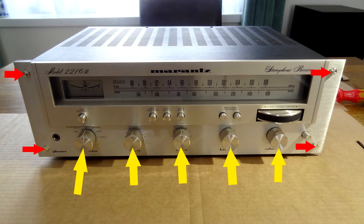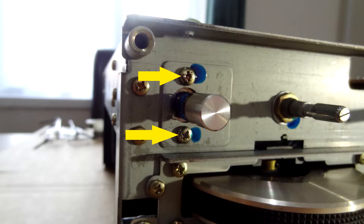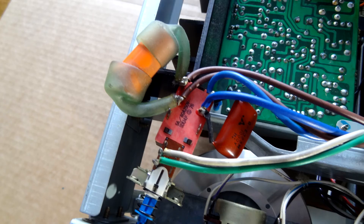Now looking at the top you can see the switch in a black box with an orange capacitor inside. I've highlighted it there. To remove that complete unit you need to undo these two screws holding the switch on the front panel. Once those two screws come undone you can take it out and have a look at the switch. Straight away, get your camera or phone out and take pictures from a few different angles so you know where all the wires go — just in case you forget later.